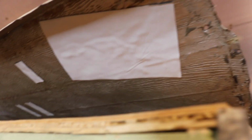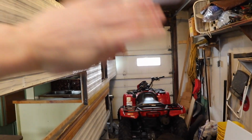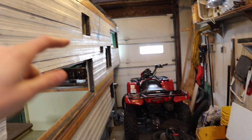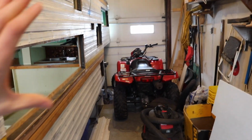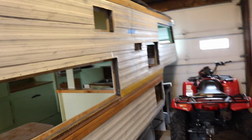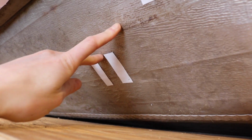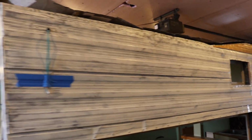I didn't show this, but underneath here, as you can tell, there's a bunch of pinholes and everything. So we picked it up and we laid it and opened the garage door and laid it in front of the garage door, almost like took the place of the garage door, and then took a shop light and shined it on the back side of it, and then marked the underside of the roof with a Sharpie where the light shined through, where there was little pinholes. Put a Eternabond roof seal. The same thing I did with the siding. Same trick there. So it's a little bit double protection.